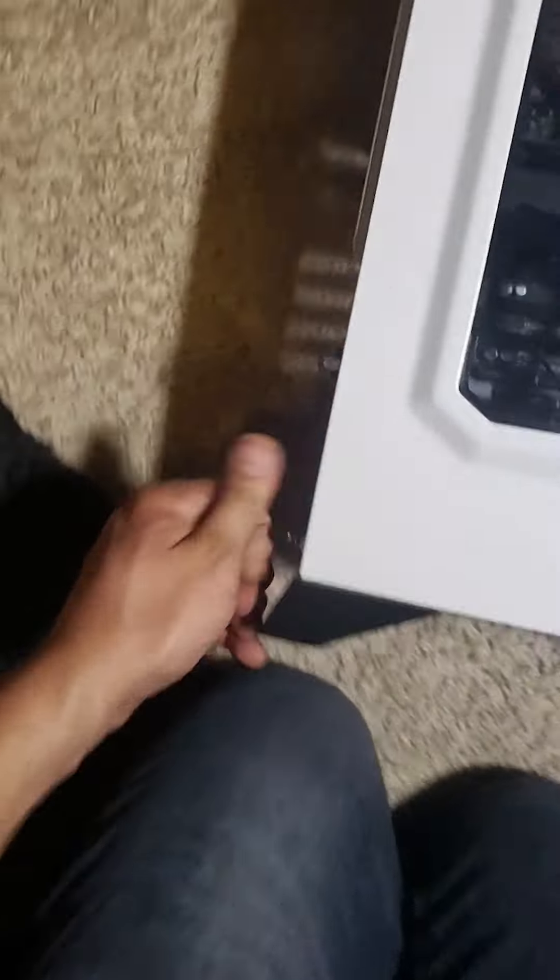Now that we have this disconnected, let's open it up — what are we working with? I have four slots of DDR3 RAM, totaling 16 gigs. Today we're going to replace those to upgrade it to 32. I should probably clean the insides of this thing while I'm at it. Very careful — let's pull this out.